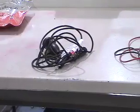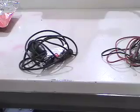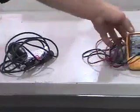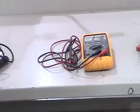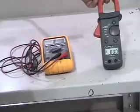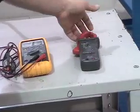During voltage drop testing, there are three primary tools required. The first instrument is your remote start switch, which is used to control or activate your solenoids and relays. The second is a good quality voltmeter, which determines what the voltage drop is across your circuit. The third and final piece of equipment is your ammeter, which measures the total current flow through your circuit.